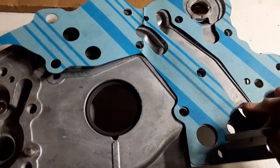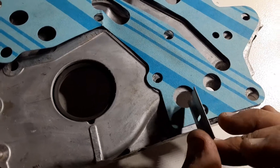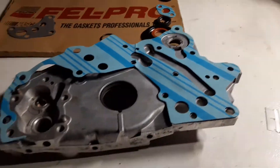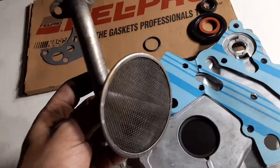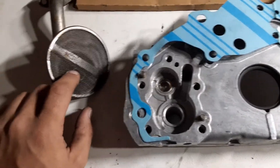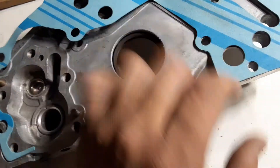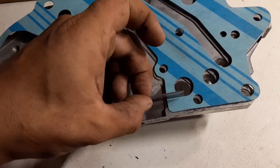You get a razor blade, and one mod—I think it was Joe Wrenches—said to cut out this section right here of the gasket, which is a really good tip. Apparently a small chunk came off of here and got stuck in the oil pickup screen. And if you look at it, this section right here never touches a gasket surface anyway, so cutting it out isn't really going to do anything negative. I'd say just cut out here and there.